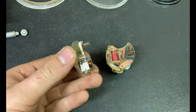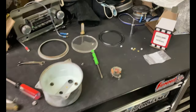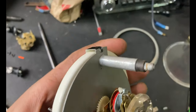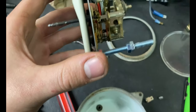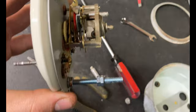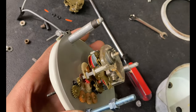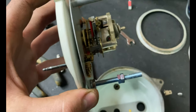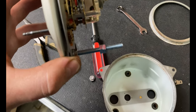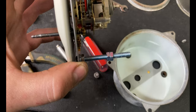We're going to swap these around, clean up this point because it's still pretty dirty, pop that on, toss the clock back together and it should be ready to go. The clock is going back together. These tabs go together a lot nicer when you can bend them while they're out like this. For the broken stud, I've got a nut tightened down and then two nuts jammed up against each other at the same height as the stud. Is it ideal for a restoration? Absolutely not. But you're never going to see it - this is a driver car, not a show car. It maintains structural integrity and does not compromise the look of the car.